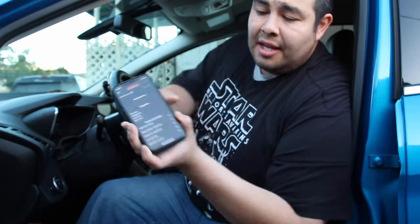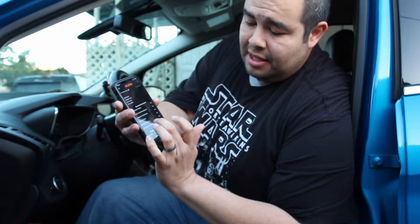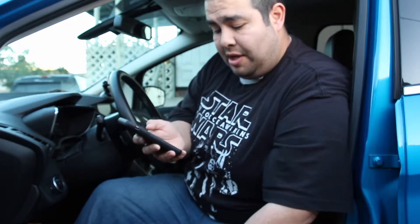You can see it right there. You connect to it and it'll give you any diagnostic codes and any problems that you have in the car, and it'll read them out to you right away. Not only that, but it can give you parameters — like how much battery life you have on your battery pack, different diagnostic settings like your fuel system status, your engine cooling temperature, and ambient temperature.